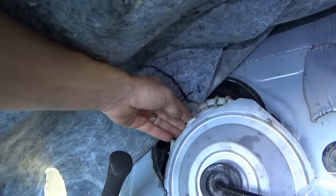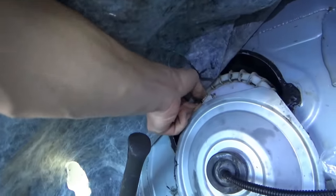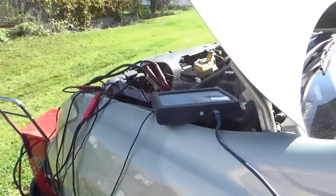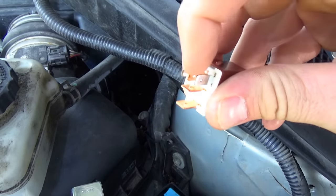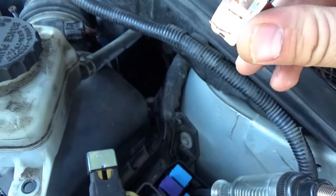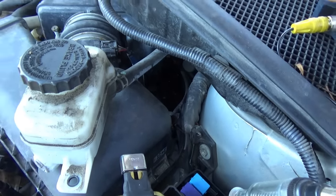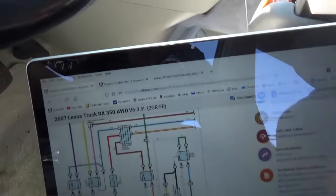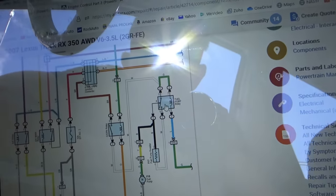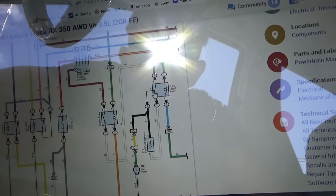This connector is slightly painful. Test light went out. So, looks like the middle pin goes towards the fuel pump. These two must be the control, and the two fat ones must be going towards the resistor, or something like that. So what did we just determine? The pin that goes directly to the fuel pump must be the middle one.